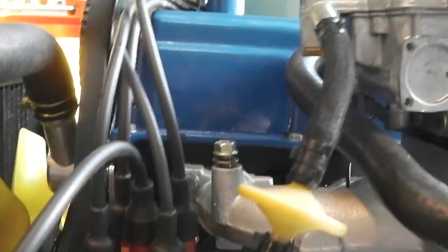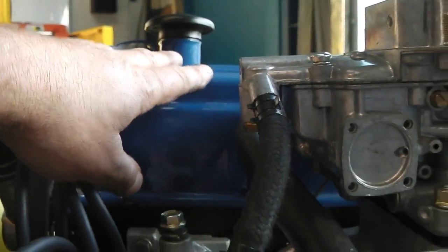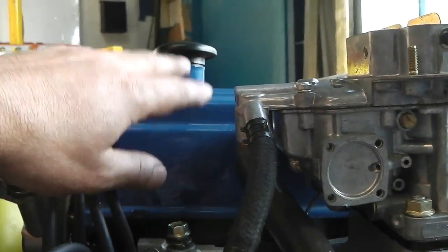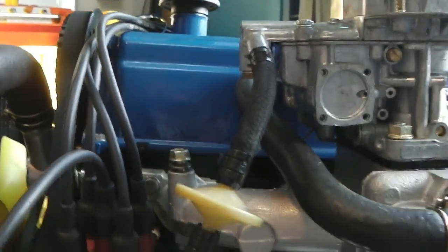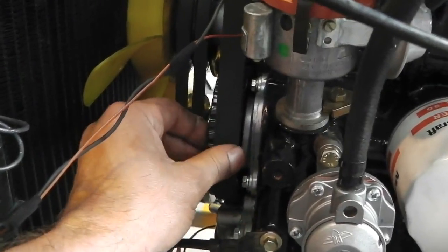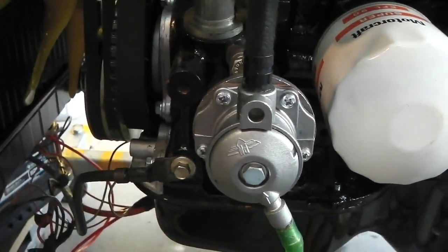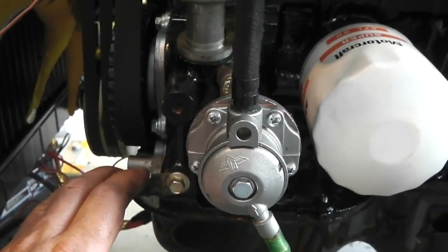We did the follower gaps you saw, and all the setting up of the cam, and we checked that the spray bar was operational, so we knew we were getting a good delivery of oil. We'd already primed the engine using the electric drill when there was no belt attached to spin the oil pump up. We'd nipped up all the bolts, okay, we've loctited everything that we had to.